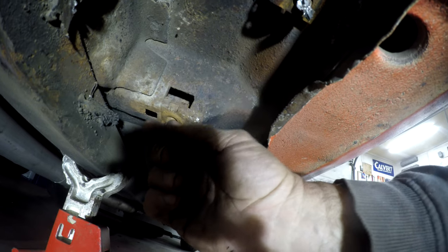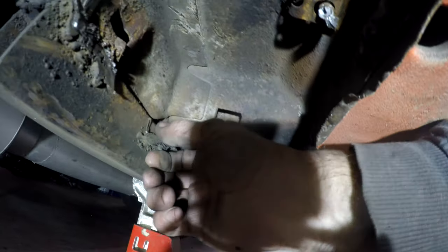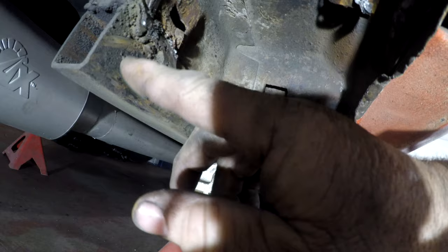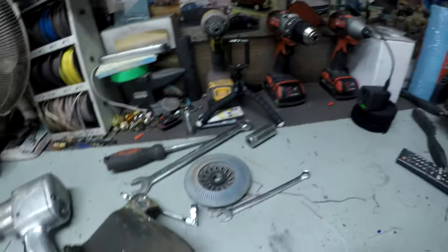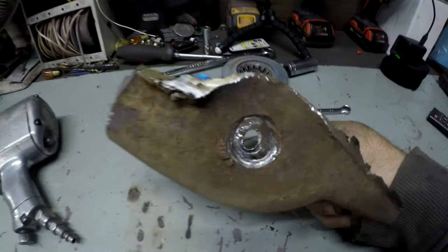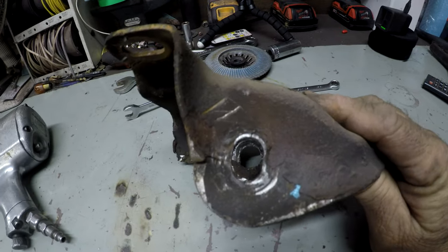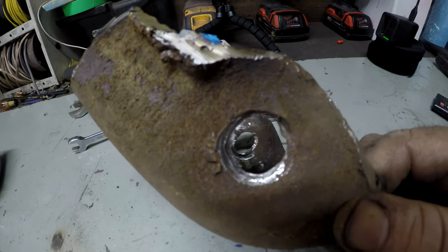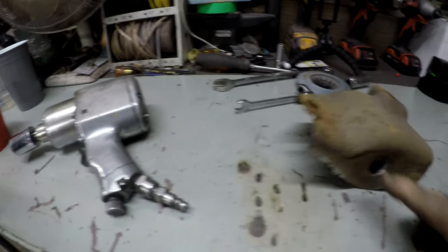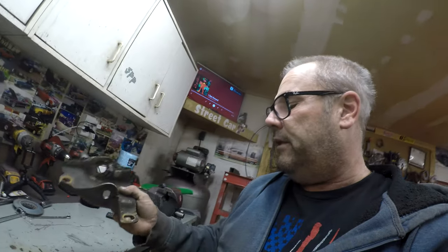There it is — an encapsulated-type nut. The floor is still good so I'll just have to get new ones of these. Here's where the third bolt went — I welded it. I could make it so I could bolt it, but I'll probably just bolt it like factory in those two spots. Look at that hole — it should be a nice circle but it's cracked here and this one is stretched out unbelievably.